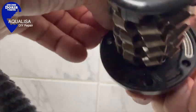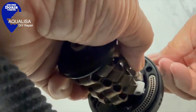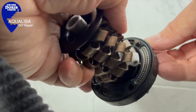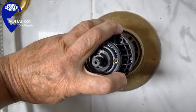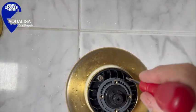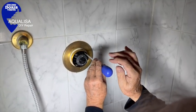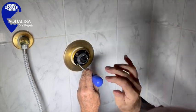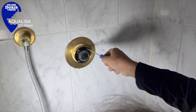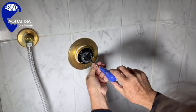Here's the trick with the actual cassette: you've got to get this washer in, placed correctly. The way to do it is to hold it in place with one or two of the screws and then line the whole cartridge up with the screw holes in the housing. Using a small screwdriver, make sure that hole is lined up. These are the screws with the little beveled end, going into the brass fitting in the sleeve, which we checked was in and flat. Tap it back evenly and do it up a bit by bit around the four screws.